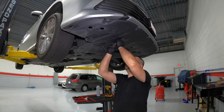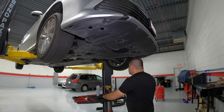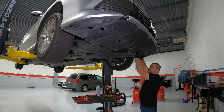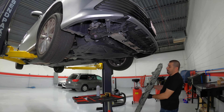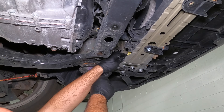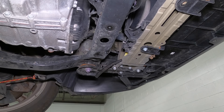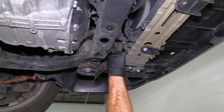One thing about this radiator on the A25A — at least in the Camry — if you just open the radiator drain it'll make a huge mess, so you're going to want to use a hose, which you'll see me do in a bit. There is no block drain on the A25A, so don't go looking for one. Just drain the radiator using the hose, let it finish, and you're good to go.